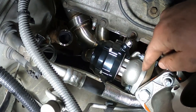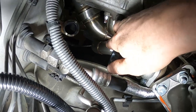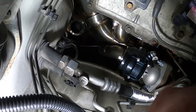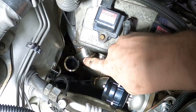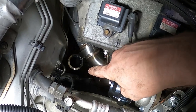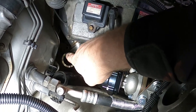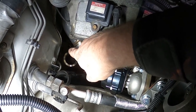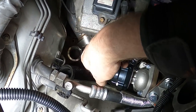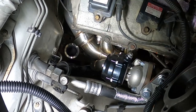There's the wastegate temporarily bolted in. That's the downpipe running down underneath the truck, and you can see the V-band down there with the stock exhaust bolted back on. Now I can start laying out where the downpipe is going to go and sneak it down through here. I'll have to do a little work for the dipstick tube — I think I can bend that and get it out of the way.